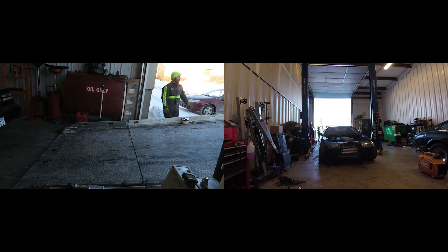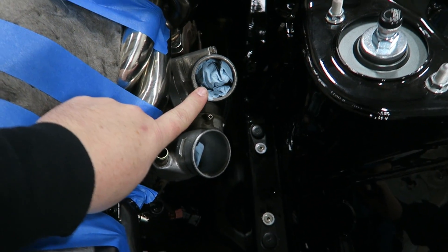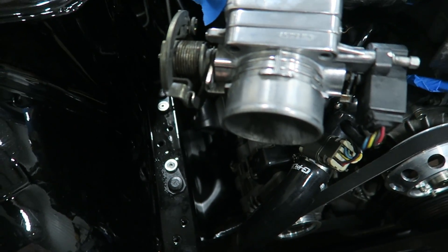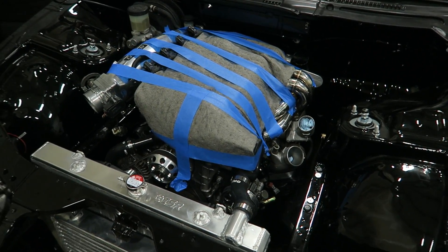What we're going to be doing is titanium intercooler piping on this thing, like I said before. Now there are a lot of reasons why we're using titanium versus aluminum, and part of the reasoning is not necessarily going to be cost — we kind of threw that out the window. We'll get into that in a second. We're going to be running titanium from here, which is the turbo outlet, into the intercooler which is actually down in this general area, and then on this side the charge pipe will run from the intercooler right up to the throttle body. It's going to be two and a half inch, one millimeter thick titanium.